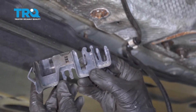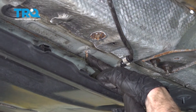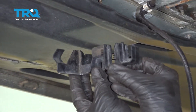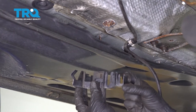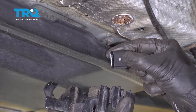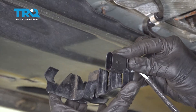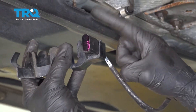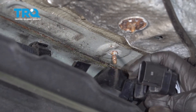Grab the plastic bracket — looking along the top of it you can see the tiny hole that needs to slide over the mounting stud on the body. When you put this in, it needs to be in this position, with the area to slide our connector into right along here. Take the connector, make sure the tab where the lock is is facing towards you, and slide it right down into position. Lock it in and make sure it's nice and secure — you don't want this wobbling around while driving. Start putting this up and underneath the shield and reconnect the electrical connector.